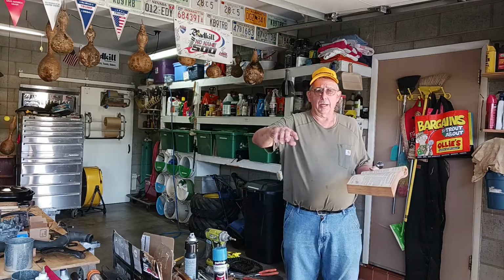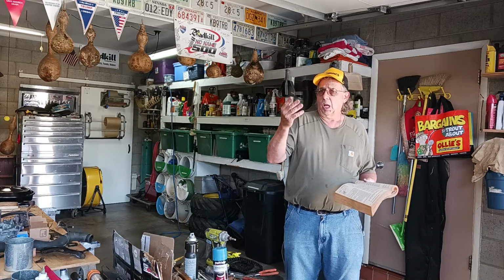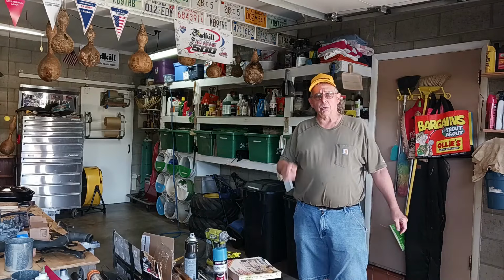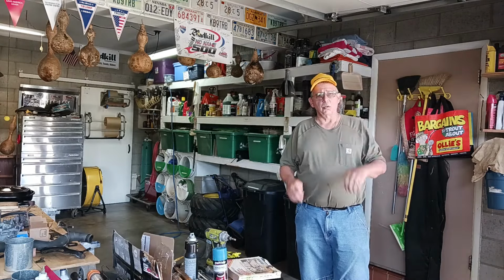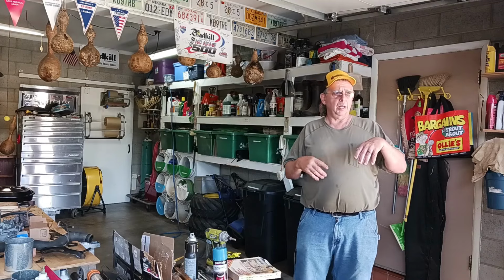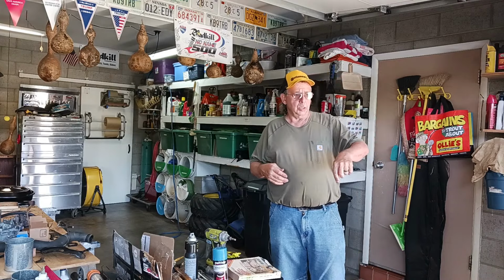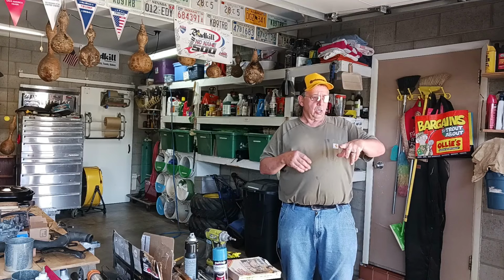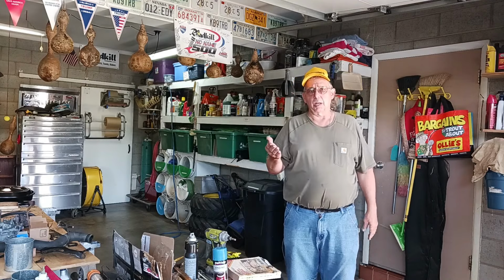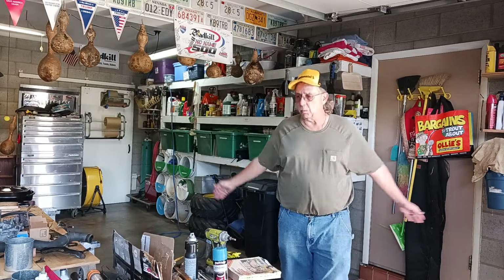I thought you were supposed to turn them another half a turn once they were seated against the, you know, I don't know. So then I get on the YouTubes, right? And I've watched three videos. Each one of them is different. The one guy says rotate around till number one is up on top dead center, and you can do number one and number two, or number one intake and exhaust, and then you can do like number three exhaust, and so on and so forth. Which sounds like the way you do a Ford, okay, with hydraulic lifters.